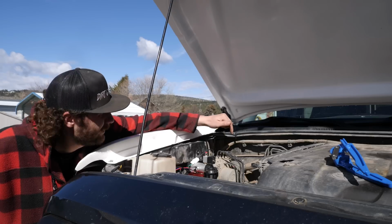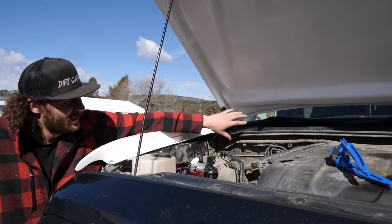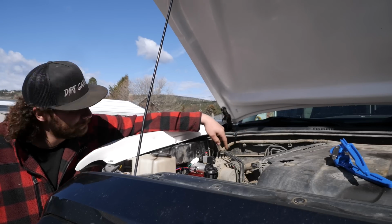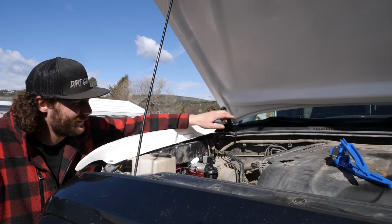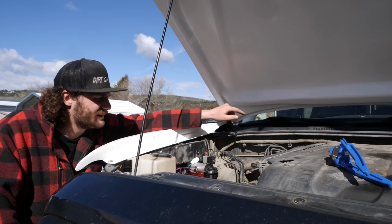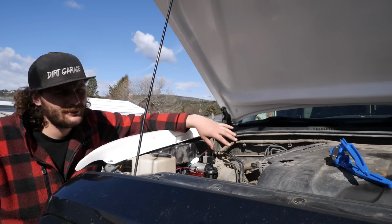So here's the plan. I'm going to keep the ABS block here and use that as kind of a brake distribution block because the brakes will still work fine even though the ABS itself doesn't function on the truck anymore. Mostly to save me from running all new brake lines everywhere in the truck. If we pull this, we got to pretty much redo everything. So I'm going to keep the lines that go to the rear of the truck intact, and I'm going to remove the lines that go to the front wheels from this block and completely remake those.